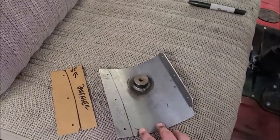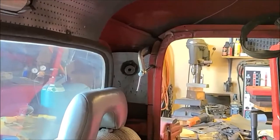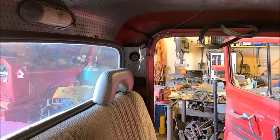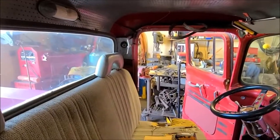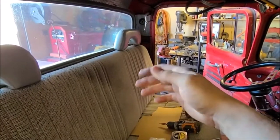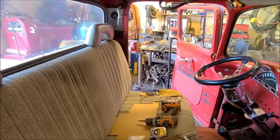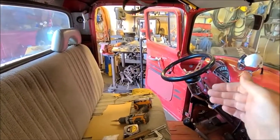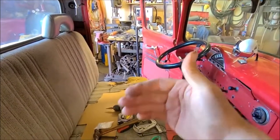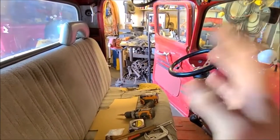I put it in there and clamped it up with some clamps to get the fitment height-wise. Then I attached my seat belt to it and adjusted it up and down to where it was comfortable for me, trying to keep shorter passengers in mind. I think as long as a shorter passenger kind of moves inward it kind of lowers it so it wouldn't rub under their chin or whatever. In these pickups, with the steering wheel farther in than a modern day pickup, if you want to sit center behind the steering wheel you're quite a bit farther inward than you would be on a modern vehicle.